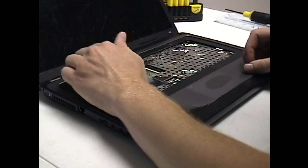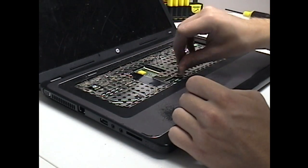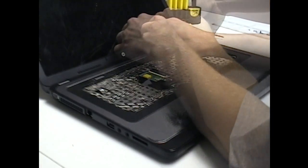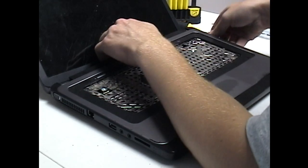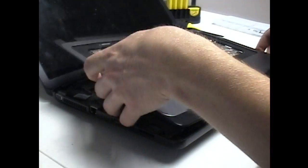Before we take the palm rest off, go ahead and unsnap the ZIF connectors plugged in for the power button and the trackpad — on mine there are three of those. Then there is one more screw that needs to be undone before removing it. From here it's just a tricky matter of unsnapping the palm rest starting in the top corners. Be careful and patient and it should start to come right out. After you get a few of the snaps done it will go really quick. The palm rest is actually the majority of the weight of the base, so after removing it the LCD will weigh more than the base — just hold it down.